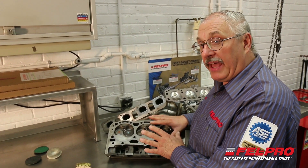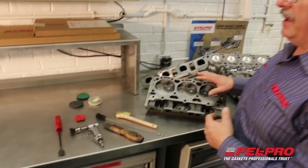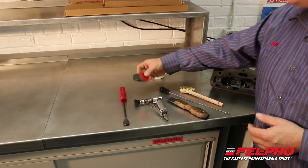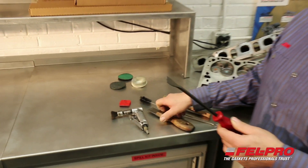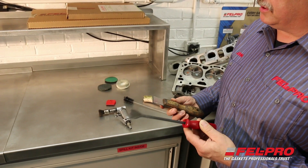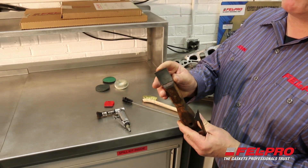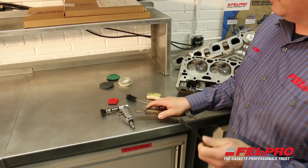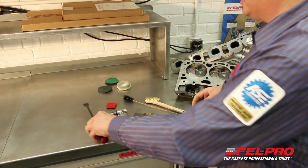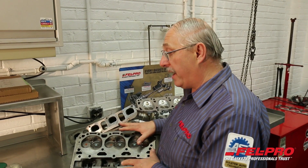You don't want to go changing that because that will affect the sealing ability of the head gasket. Some of the other tools that I use — and you probably have as well — I have a razor blade and a holder, a couple types of gasket scrapers. This is your typical carbon steel gasket scraper. This one has a carbide edge on it and it's square and flat. This comes in really handy for removing carbon and material from the cylinder heads without changing the surface finish and without gouging the surfaces that you're trying to seal.